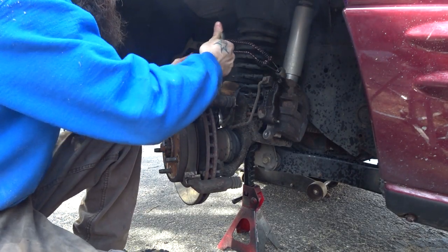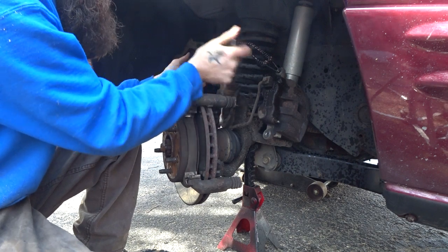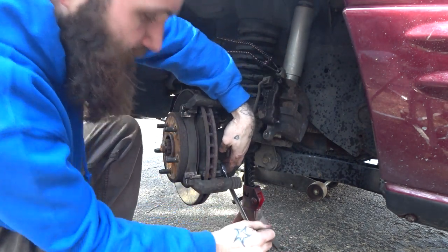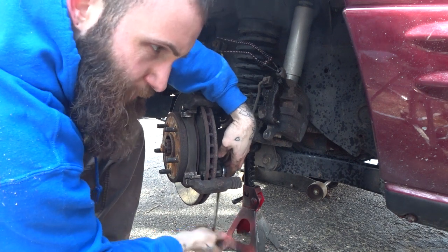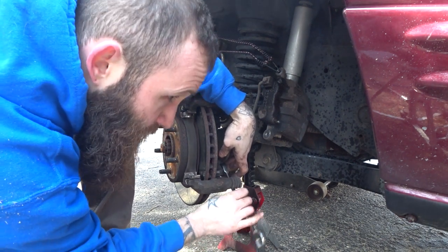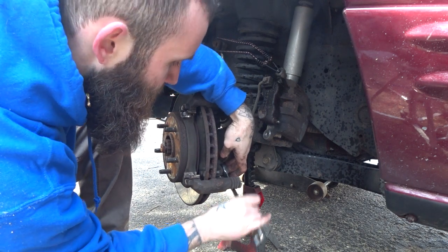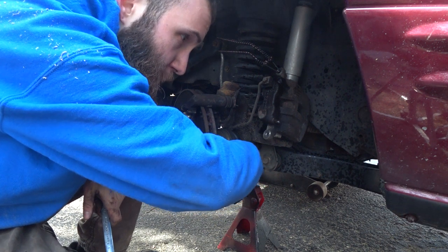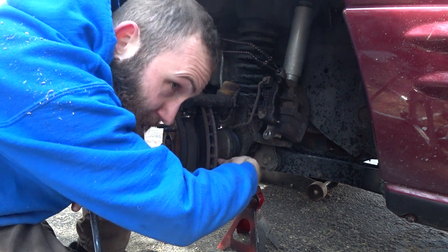The reason that this thing warps rotors so bad — it's not really the Jeep or the caliper's fault. My commute involves going over a mountain every day and I think they just get real hot. And then when it's raining or something, they get real hot and you drive through a puddle — you know how that goes. That's not a mystery to anybody. So I'm hoping maybe these HD rotors will help dissipate the heat a little bit and I will not have an issue like that going forward.